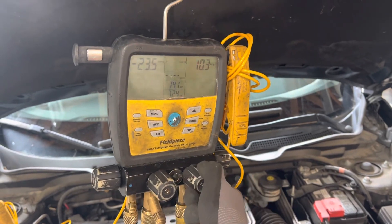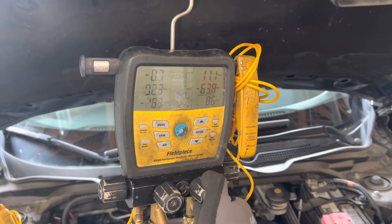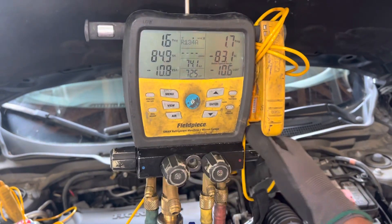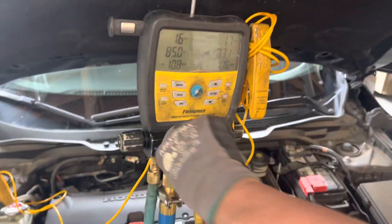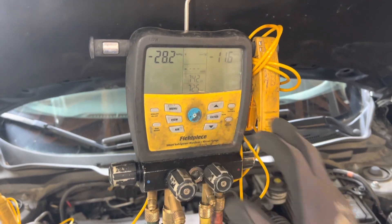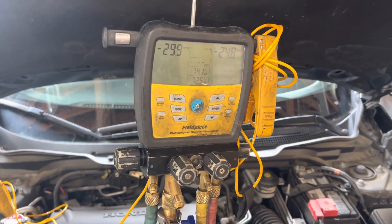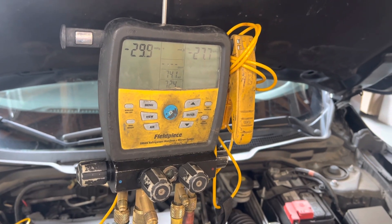So let's put a little pressure there. As you see it went up and then comes down — I just want to bring it to zero. There we go, 1.6 psi both sides. Now I'm shutting the high side and I'm going to recover on the low side. I sweep through — opening the low side and opening the vacuum on the low side. So now I'm sucking from the low side and any minute amount of R134 left in the oil and gas is being swept out. I'll just repeat this three times and we'll get it down to the micron range.